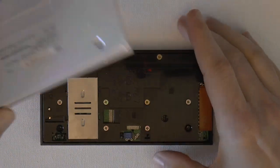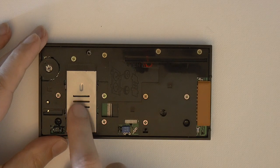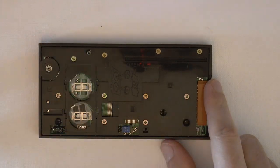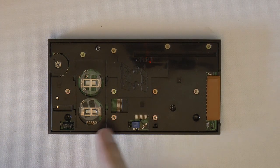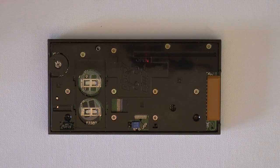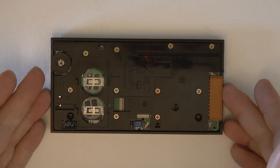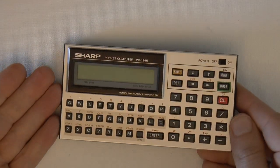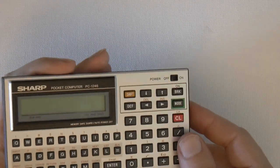It may take a little doing, but there's nothing you can really break on this. Inside we have the battery compartment, and if there are any batteries you can remove them by sliding the battery compartment up. Normally with LCD replacements I suggest putting the batteries in to see if there's any functionality, but the PC-1246 has no speaker, so there really isn't any way to verify functionality with a dead LCD. That's why replacing the LCD is not a guarantee you'll end up with a fully functional pocket computer.